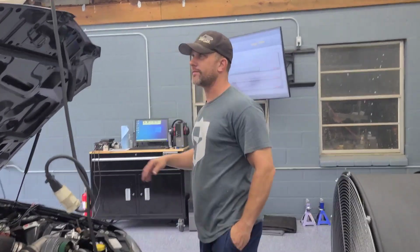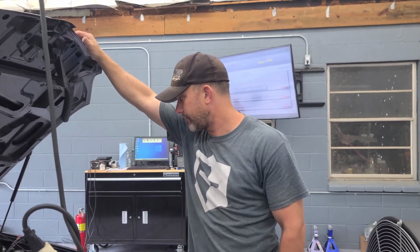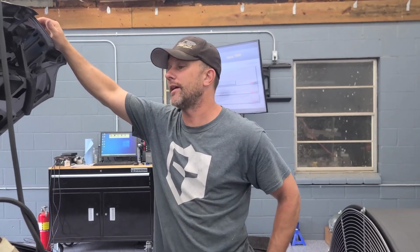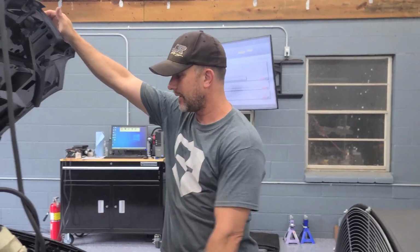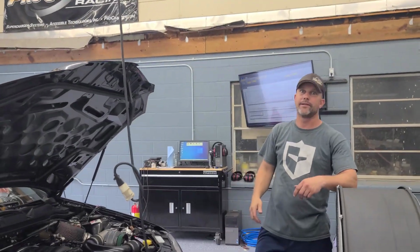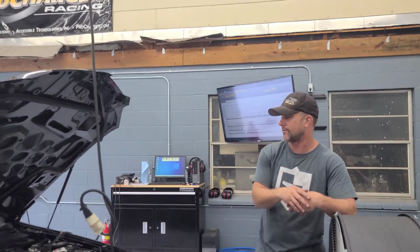Do you know what cam's in this? I do not know what cam is in here. We'll find out. Juan just went to the new BTR4. Centrifugal? They're all motor BTR4 version 2. He had the 4 version 1, right? Yes. Because it was big. We were like, this is an NA cam. Of course, NA cams seem to work pretty well. BTR's red hot cam is their NA stage 2, PDS stage 2, and centrifugal stage 2. Same thing as that. Yep.